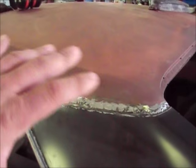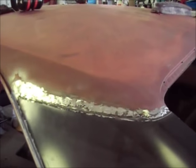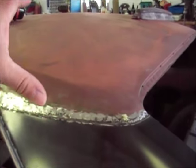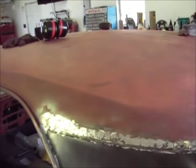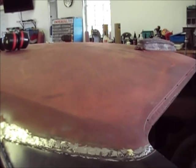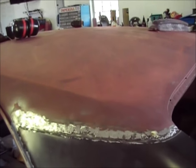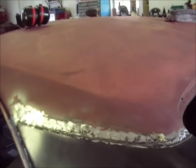Like I said, I got this stuff here, so I could go ahead and put it in up in there. I need to clean that stuff up real good though, so I'm going to have to get in there and probably do some work before I do that. But I've been kind of excited to try this, so I'm going to go ahead and wax and grease remove this the way it sits right now, make sure I get any crap off the surface. Then I'll start with my grinder, take probably a 50 grit disc and take it all the way down around this, clean it up real good, and then re-clean it again, until it's just spotless. I'll probably wire wheel a lot of the little pits and little areas like that, and get them all cleaned up to where it's nice shiny metal.